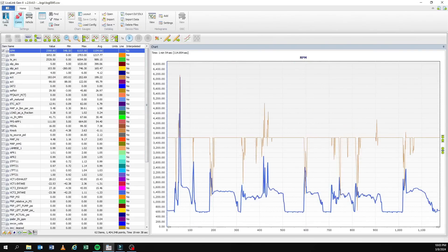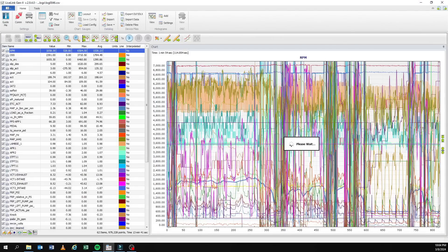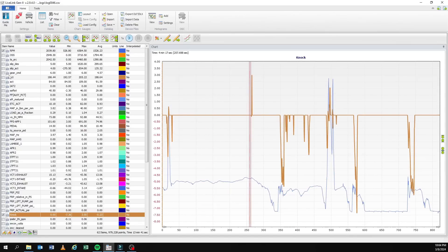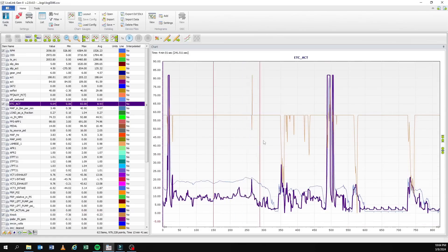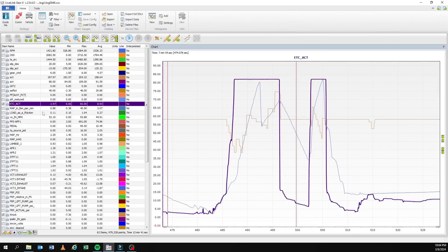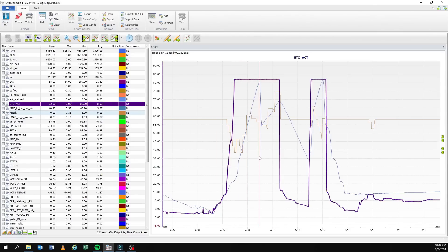Log 46 — which I haven't reviewed yet — is 93 octane mixed with the quarter tank of 87 from Herlong Ford. Again, we highlight the knock PID. We got a little bit of knock right here, but look at what happens — it's not under any acceleration. It seems to be just a blip at a very 12-degree throttle angle. The knock was three degrees, but this is a very sensitive knock sensor and it was not under wide open throttle. Right here is wide open throttle — ETC actual, wide open throttle. Look at the knock sensor compared to the previous log. Negative, negative — it starts to creep up positive, then shifts and is still negative.